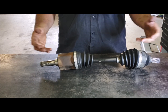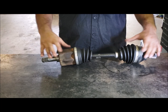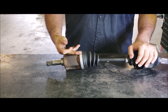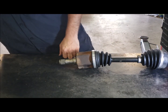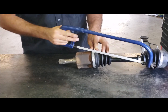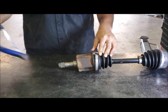Previously the only solution was to buy a complete shaft, because Ford and Volvo don't sell the individual parts. But now you can buy them from aftermarket suppliers. If you can change a CV boot, you can rebuild this. First, we need to cut the solid metal band - it's very thick and heavy duty, press fit, so once it's on it's on. If you've got an angle grinder, just cut through it. If not, just gently saw through with a hacksaw - it won't take long.